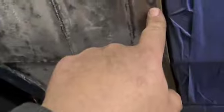I trimmed down that piece of rod and put it behind here, and I tacked it, just to stiffen up the fender. That's how stiff it is without even a stay in it. This time I bolted the fender on, I put the bolt over here that belongs. So that's right now. And that actually lifts the fender, so it gets my body lines right. Except for that little dippity thing there, but that's the way they are.